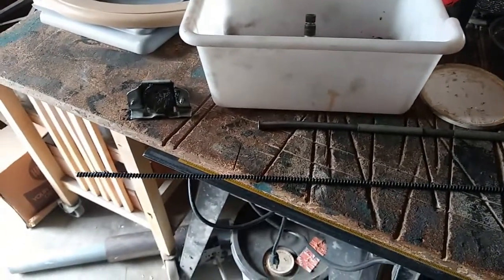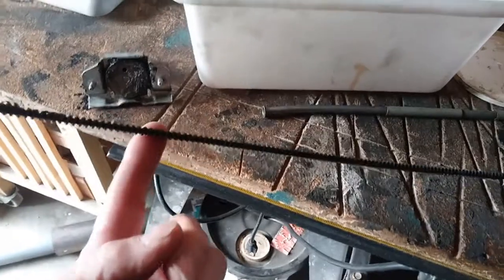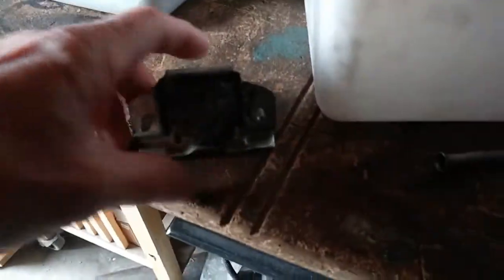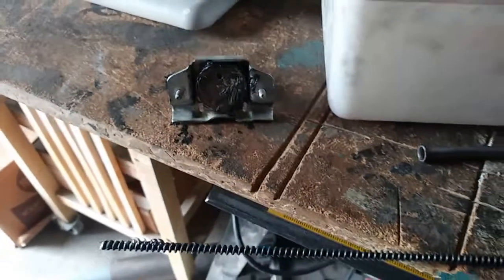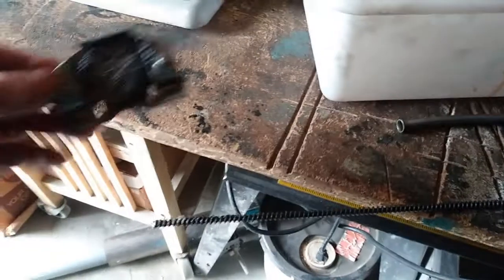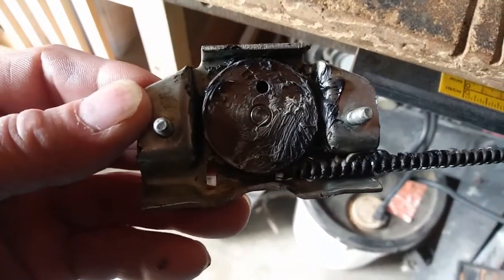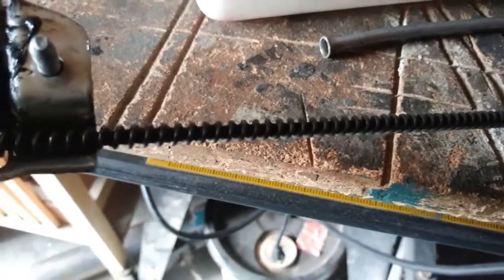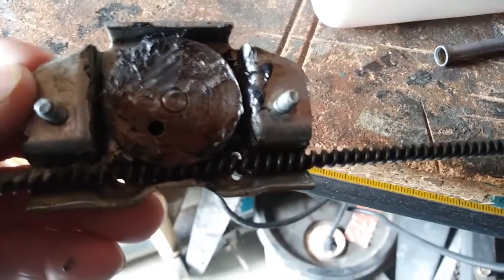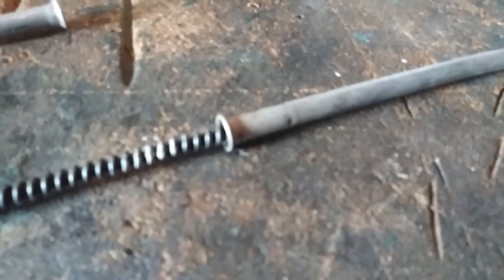How about a quickie on how to thread the MG windshield wiper coil — this guy right here — into the shaft. How they go is, you have to thread them on so they will thread through this end here, and then they wind onto that cable.